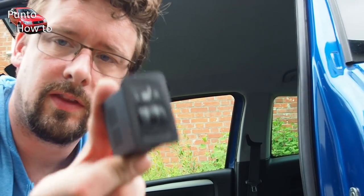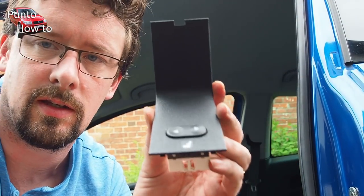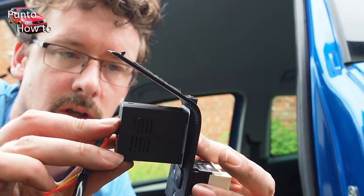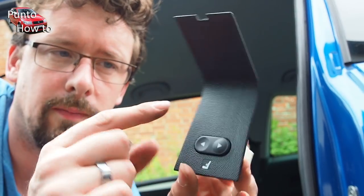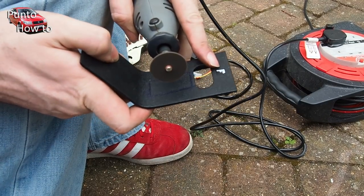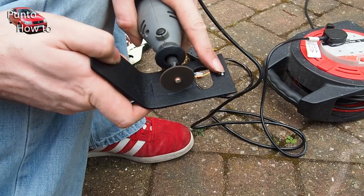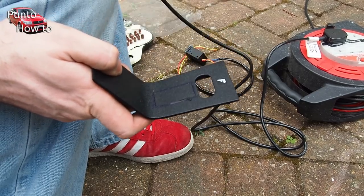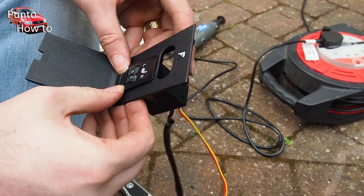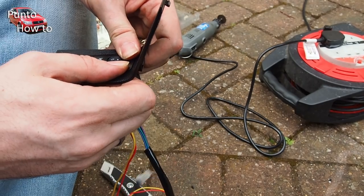I also have to fit this switch into the panel here. This panel sits in the car and the switch is going to have to go in the middle, but it is ever so slightly longer than where the curve is — so I'll need to very carefully trim it into the edge for the curve so that it doesn't look too odd. Very carefully using a rotary tool I cut out the size of the switch, starting smaller than the switch so I can enlarge the hole later, just to make sure I don't cause serious damage to this panel because it would be difficult to replace. I test fit the switch a few times to get the alignment as best I can. There is still a little bit of a curve in the bottom of the panel, but I may try to address that with a little bit of heat or maybe 3D print something in the future to help fill that gap.